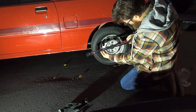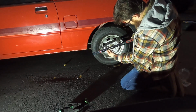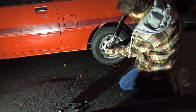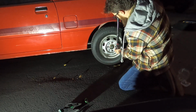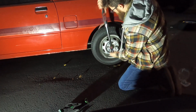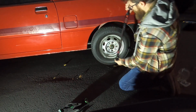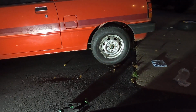You can store different torques that you use frequently, but I like to take the batteries out. Easy enough. You can see from back there when we've hit the right torque. And there slipped the brake. Doesn't seem like a lot, but tiny 10mm stud, so that's what they're spec'd for.